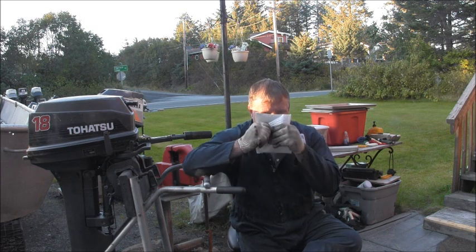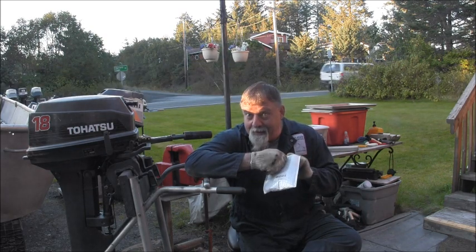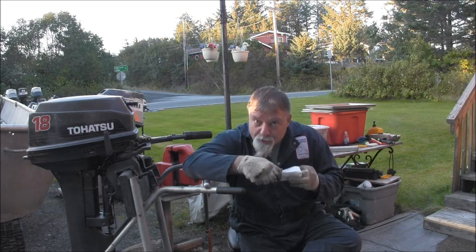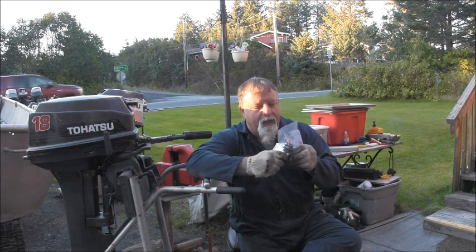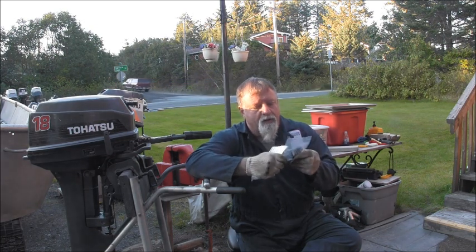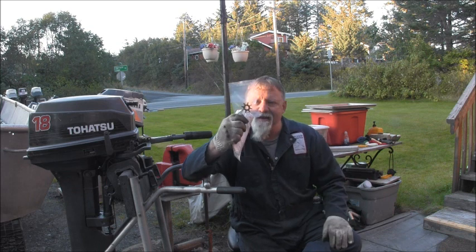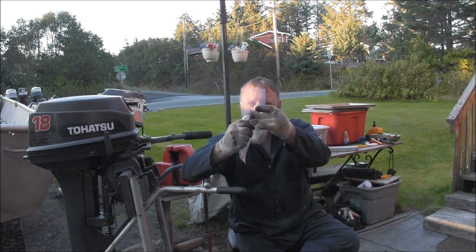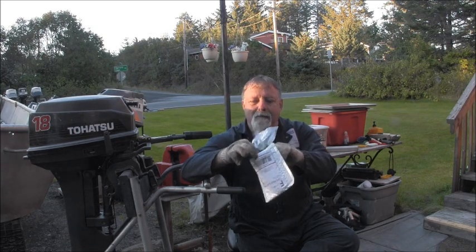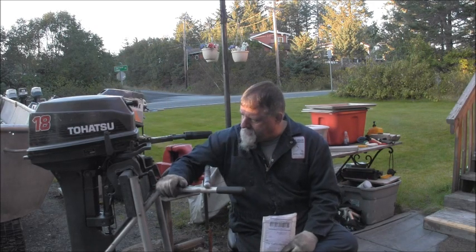But guess what's in here? It came in the mail. I'll give you a hint. If you remember when we did this Tohatsu, I did everything but the lower on it. And so I finally got me a water pump impeller. It's got 8 fins on it, and it's got the nylon center. But that will be in probably my next video or there soon about. But I got the water pump so I can get a new water pump in this one.